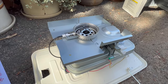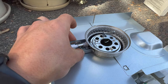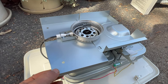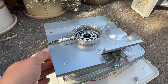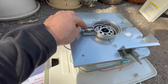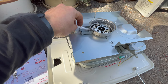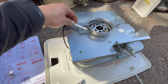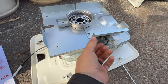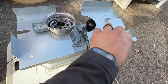Next step after removing the body is unscrewing the one screw that holds the igniter. We're going to pull the igniter out, then separate the two wind covers apart — be careful, the wind covers are very sharp, so don't get cut. Remove the screw, pull the igniter off, remove the little bracket, turn it and pull it out of the way. Separate the two wind covers by pushing the bottom part down and pulling that part off.